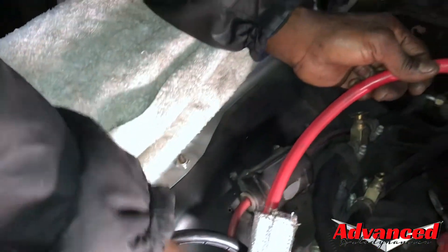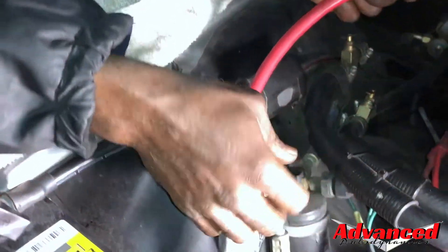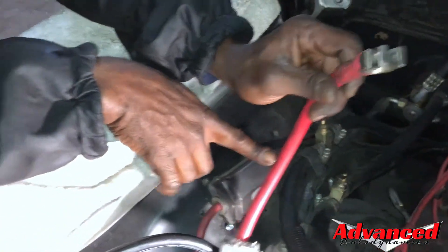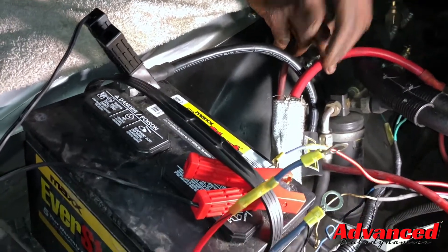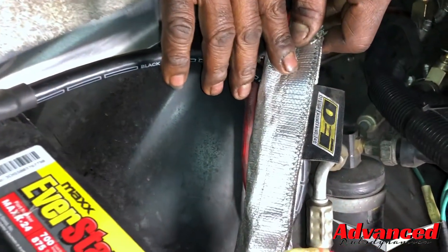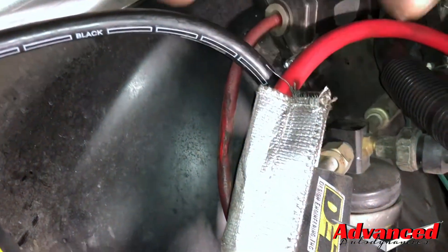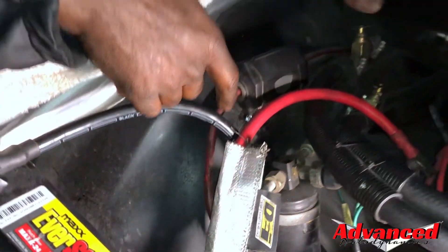We also replaced the battery cable because it was a typical store-bought cable, which had a thickness of about this. Being a 454 Chevy, we actually liked the larger cable, and these cables were custom made for us by a shop here in Dallas. We also added heat wrap — a DEI product — and ran it between the headers and the heat shield on the starter, down to the starter bolt itself on the positive terminal.